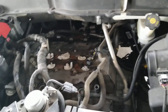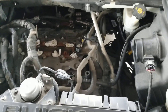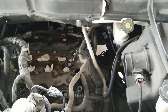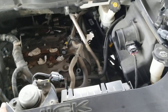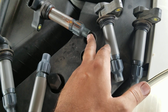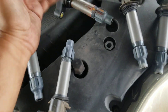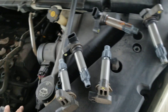I'm going to pause and talk to the customer — I know he's not going to do a head job because of this. This will probably be accompanied by misfires and P0300 through P0306 codes, as stated in the bulletin. What happens is the oil gets in the boot with the spark plug and starts jumping to ground, so it doesn't allow the spark to reach the combustion chamber.